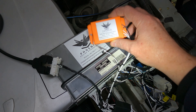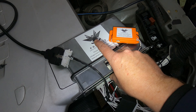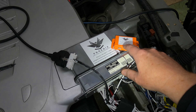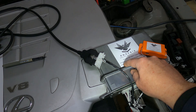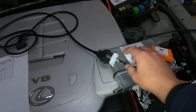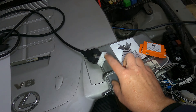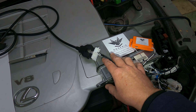This is also your CANverter device. It's converting the CAN coming out of the 3UZ 6-speed Crown to MPX, which is what the IS200 slash IS300 Altezza reads. Because this uses CAN and not K-line communication like the IS200/IS300, we've fitted an OBD2 plug that's going to live inside your ECU box - that's the one you'll use for diagnostics.